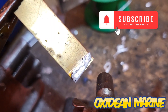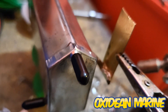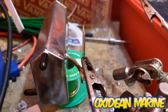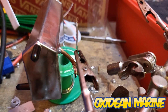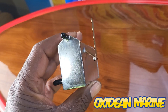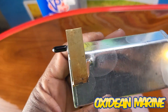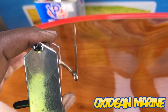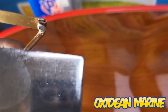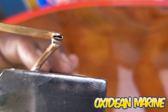That tinned up real well - let's mate it up. I jigged it up and soldered it. It could be a little bit off but it's brass, I can bend it right into shape. It's actually very straight for having been eyeballed. Now I'm gonna mount it up, mark the hole, drill it out, and cut off the excess - and we've got a hung catch can. I also have to solder that mouth shut because that could be an air leak or fluid leak.